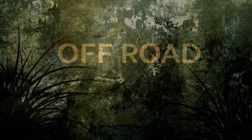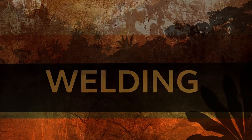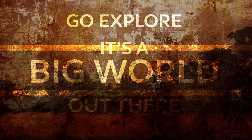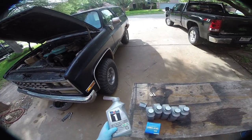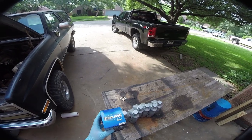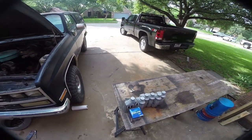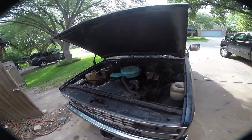We want clean fluid front to back, start to finish. The first thing we're gonna start with is an oil change because I got the truck hot and in the driveway. This is kind of the return of the helmet cam — let me know what you guys think. For the oil change we're using Mobil 1 10W-30 and a Purolator filter PL34631. This will be the same for all 350-powered cars and trucks. I'm not sponsored by any of these people but these are the brands I use in my cars.